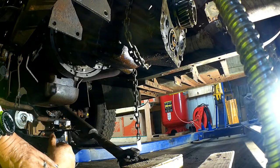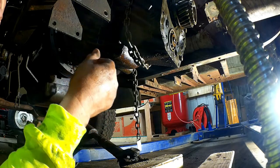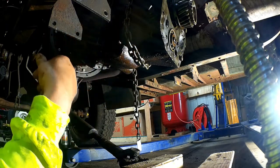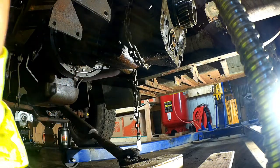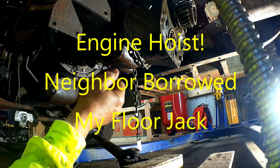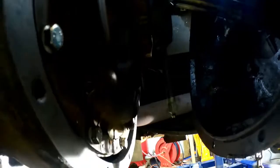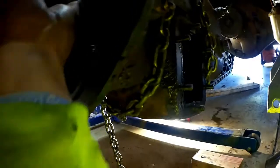Change of plans — I'm not using my transmission jack. I've got to make a decent cradle. This thing has all these adjustments, but the platform just plain sucks, so I got my floor jack and chained up my transmission to it. A couple of things you've got to make sure of: block your two blocks in here on your throwout bearing, and you have to make sure that the tines — the operating forks for the throwout bearing — are up, not down, because they need to slip behind the bearing when you put the tranny in. I'm going to go ahead and push it into position.